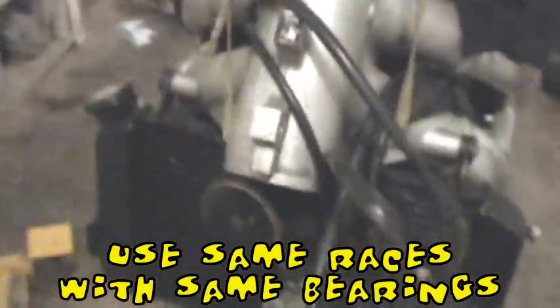We've got the bottom bearing to recycle off the SV650 lower tree — I got that knocked out and the race put back on. I got everything greased up, including the inside lower race in the frame. That bearing was in good shape because I replaced it less than a year ago, so we're going to reuse that one. This whole front end is ready to get pushed up into place. I've got a triple tree fork lift for the front of the bike, so I'm going to put it on this stand and jack it right up into place, then slowly lower the bike down onto it.